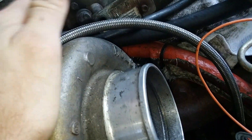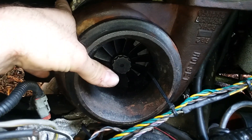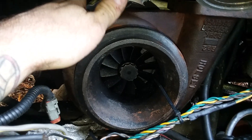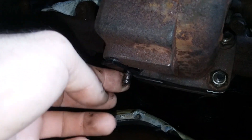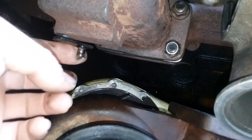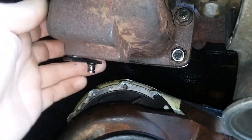You can use a stock oil feed line - you can see the length is just fine and it'll be out of the way. This is the HX35 I'll be using; I've got it moved out of the way right now because it weighs about 55 pounds and it was in the way of some fitment stuff. Another thing you'll need is either some sort of external wastegate and block this off, or what I'm planning on doing is getting one of the spring actuators online and just attaching it so it's held closed, and when it gets to the preset spring tension it'll be able to open.